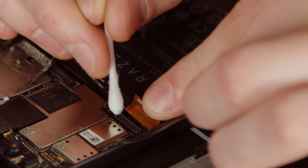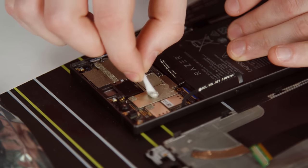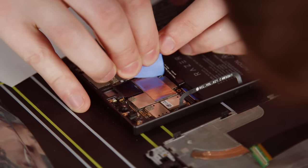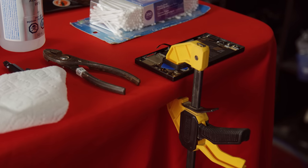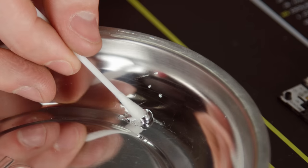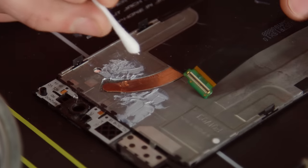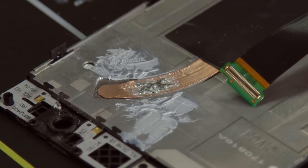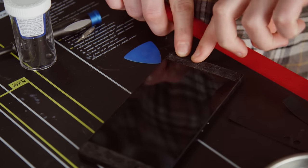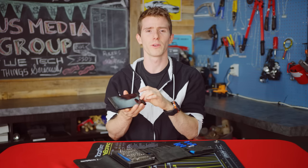Time to execute. We applied conformal coating around the CPU with a cotton swab to act as a line of defense if the liquid metal spills off the CPU. Then to put the copper heat spreader back on, we used Arctic Silver thermal adhesive, which you mix in equal parts and spread across the surfaces you want to stick together — just like an epoxy. We cleaned the copper spreader and carefully placed it back on, removing any wrinkles with a guitar pick and clamping it all together for about 20 minutes to make sure it was set. Moving over to the back of the screen, we applied a generous amount of thermal paste, and then it was finally time for liquid metal. We put a small drop in a cleaned parts tray, then picked up a tiny bit with a cotton swab and carefully spread it over the copper heat pipe — you only need a little bit. For reassembly on the Razer Phone, I'd strongly recommend getting new speaker grills first, because they don't just stick back on. We used what we fondly refer to as 'sticky tar crap' to put them back on as best we could — I give it a 4 out of 10.